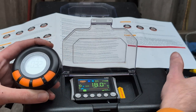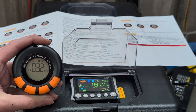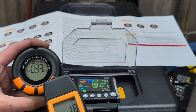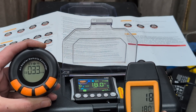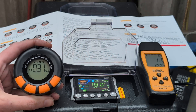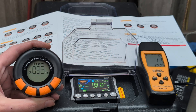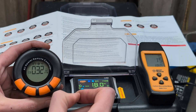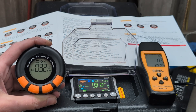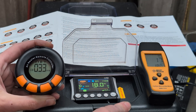There is a way to display the carbon monoxide level it's reading — it's reading 32 right now and I've set the alarm to 30. This one's still showing 18. Over-reading is good; I'd rather it over-read than under-read. It probably could do with a calibration. There's no point calibrating in here where there is carbon monoxide — I would take it outside to calibrate it. At least it's reading the carbon monoxide in the room right now, so that bit's working.